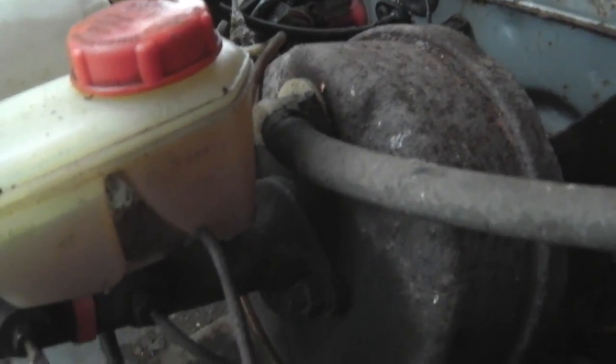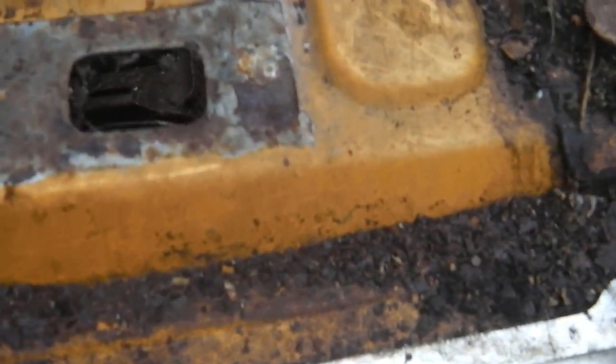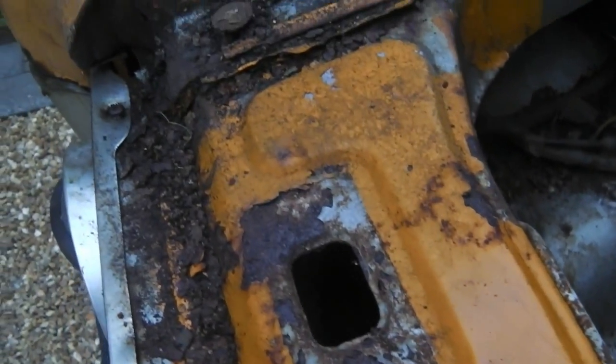Right, heater box is in good order, engine we know about, brake servo works, really good sharp brake servo, and the master cylinder's operational, no leaks. So there's a hole in that hinge top, but there's nothing here, even under the fuse box which I've had up, it's just some light corrosion. Behind them backing plates there's nothing. That inner wing's intact. That inner wing's intact. But then it's gone on the front. So slam panel could be holed underneath the wing there, but I don't know about the slam panel. It's okay, it's not bad.